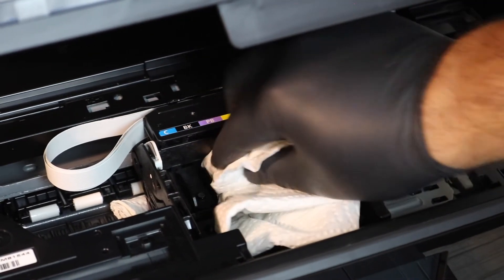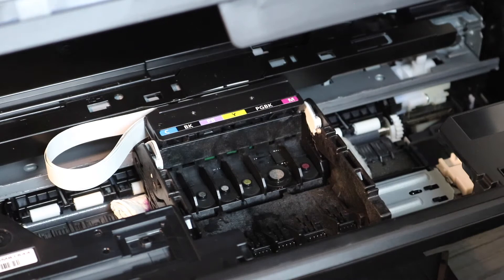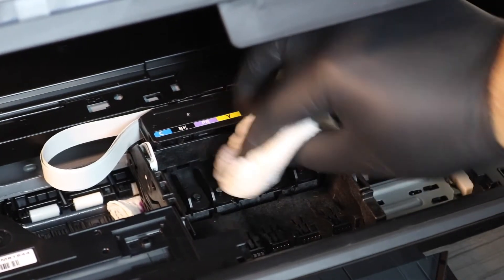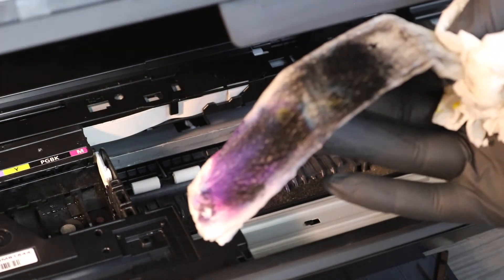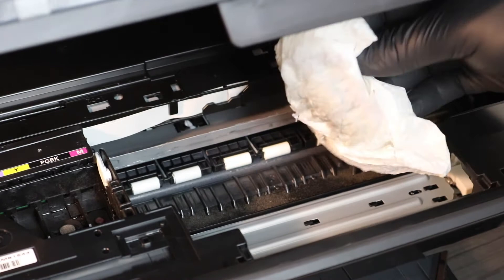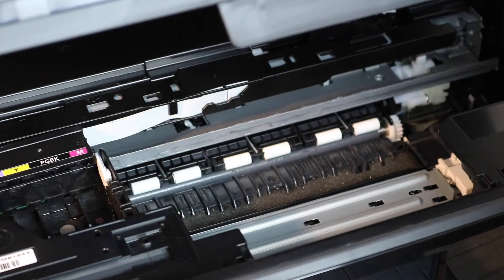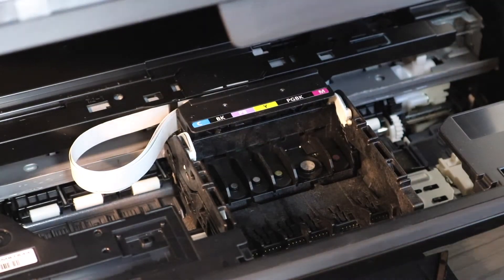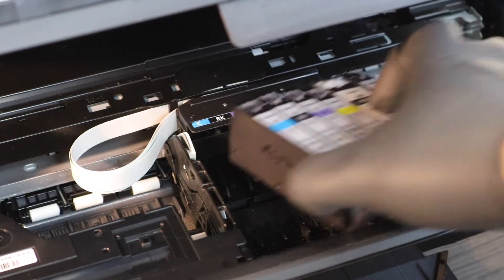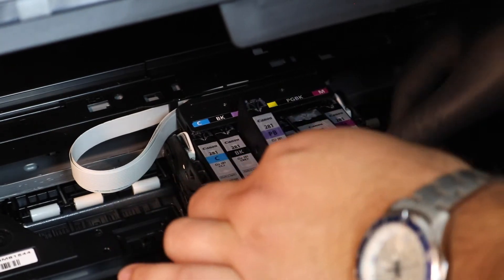Once you're done, you need to dry this off. You can repeat the cleaning process as many times as you want — 2, 3, 4 times — using as much cleaning fluid as you have. Make sure everything is dried up, all the dried ink should be on the paper towel, and you can discard that. Make sure you are replacing your ink with fresh ink cartridges and stay on top of that, because this problem will happen again if you don't keep fresh ink in your print head.